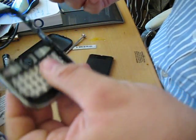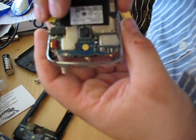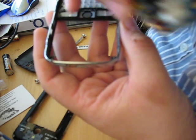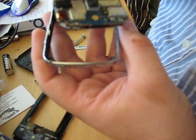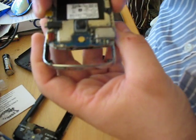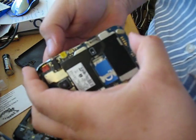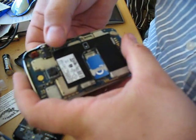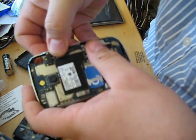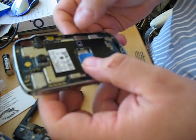Right okay, so putting this back in — so you've got the sort of main front part of the BlackBerry. I also cleaned out the back of the keyboard as well, it was full of all kinds of amazing things. Now, what you need to do here to slot it back in is you need to slide in this way. There are two little plastic prongs that sit in between the PCB and the front and the actual screen. That just slides in. Once you get that in, you can then drop the rest of it in, but you need to pull this little bit out on the side so the connections can sit in the chassis part. There you have it — went straight in, first time.